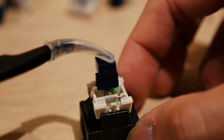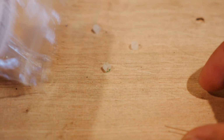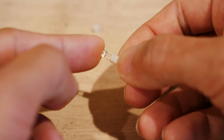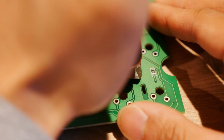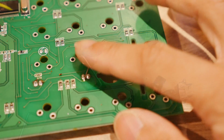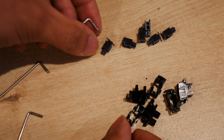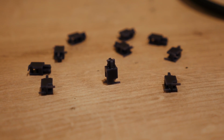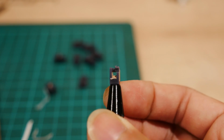The keyboard can be spiced up instead. First, let's clip off the cheap looking blue LEDs and replace them. Hopefully, warm white won't look too tacky. These stabilizers seem to be genuine cherry plate mounts, already sounding good being pre-lubed and their stems pre-clipped. Though spacebar rattle can be sorted by chasing a little perfection.